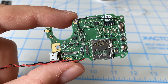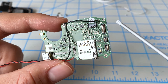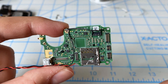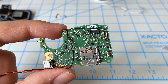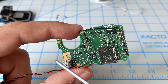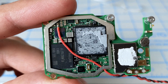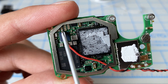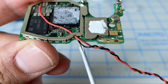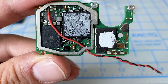Now that we have our camera disassembled and the motherboard exposed, we want to do some soldering. You want to use this ground point here — take one wire from this ground point all the way to this last piece over here. What that does is it simulates the power button being pressed, so as soon as you plug the camera in, the camera is going to be on. Then take the power cable you're going to route to the outside of the camera and connect the ground cable up here. On the other side is your positive — this capacitor here is the positive — so you'll solder to that. It's very tiny but doable with a decent soldering iron. Bring the cable down through a hole on the side, and put a little bit of glue on there to make sure the cable doesn't chafe.